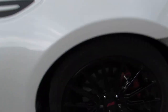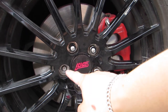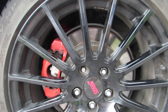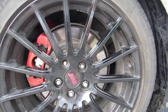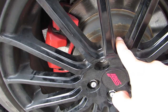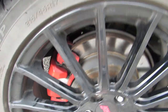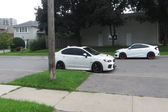Just in case you didn't see the other video, here is the messed up stud — there's no lug on it because it couldn't go on. They're both on the passenger side. What we're probably gonna do is take off the wheels and see how much space we have to work with, because we're gonna have to knock these guys out. Hopefully it's easy access.